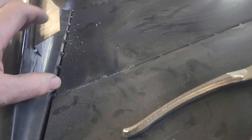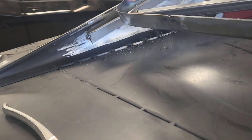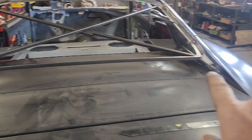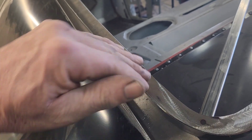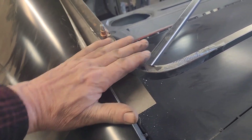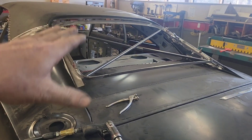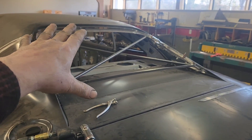I added these temporary flanges on the inside, tacked in, and also made some drill holes on the inside of the flange. I'm going to slot these flanges so that I can adjust this up and down. I want to make sure the sheet metal rolls in here so I don't have a valley or it doesn't dip down too much - I want to be able to adjust this flange up and down to where the sheet metal just rolls in to this edge right here. It's pretty good up top but a little high down below.